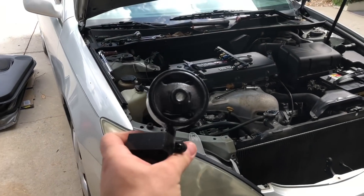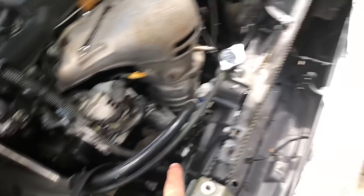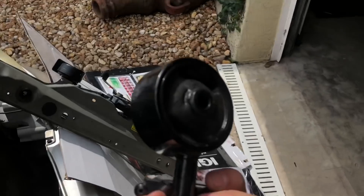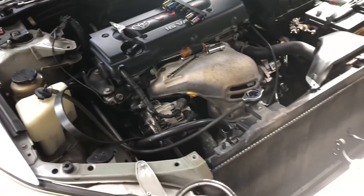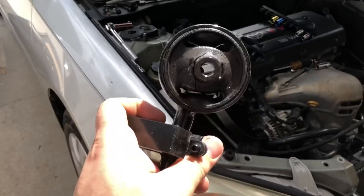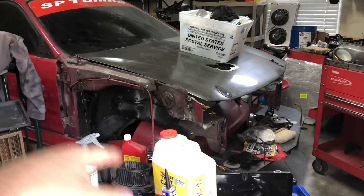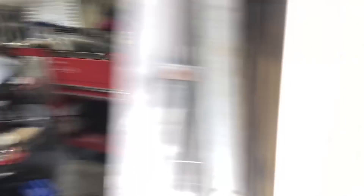The mount we're actually using is the top torque mount from a 2003 Toyota Camry. We were in the middle of replacing the condenser and the AC compressor and saw that this one was all cracked — figured that's what was causing the engine to shake upon takeoff. It's a daily driver, not like we're launching it or anything. We've done this in the past on our track Integra — we're currently building an RSX — and we ended up switching to billet mounts later, but back in the day this worked phenomenally.